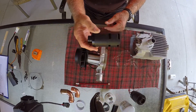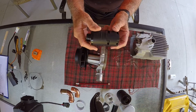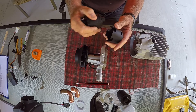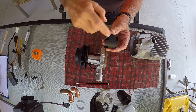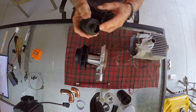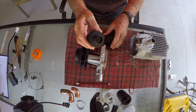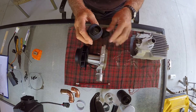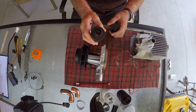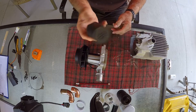We've already seen that these intake silencers are not much good. The reason they actually make more noise is because of all the restrictions inside - the air has to come up and around and back before going in. You could take it off and just use it without that baffled part, creating less restriction and less noise. But you do need a filter, and these are not a filter.